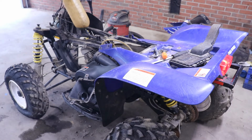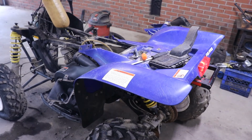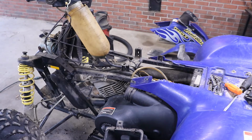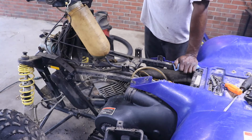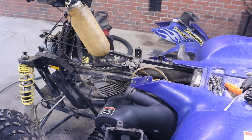I think it'll be alright because I still have to spray stuff in it to get it to crank up. And then I'm going to get a new plug for it too. I put a used one in there. Other than that, the engine sounds good. Hopefully it's not pulling air from any of the seals. But I'm going to see about grabbing a brand new spark plug, put that in there also, and then we'll try it.